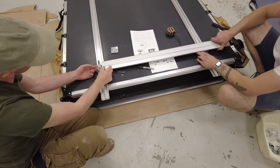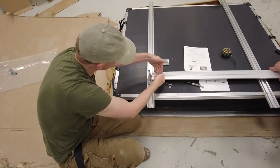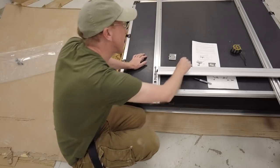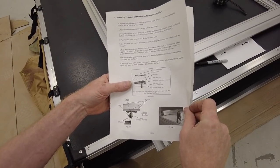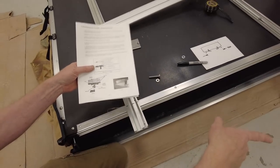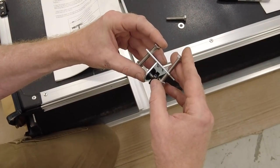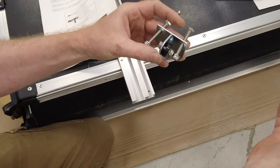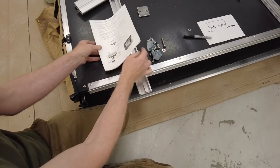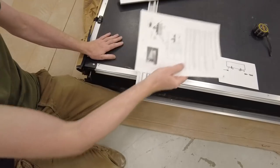This is a genuine problem with the fit. We might also 3D print a plastic spacer that follows the bar's profile to spread the load — otherwise the strap's going to start bending. On figure one, the ladder bracket bolts should have washers on both sides, but they've only supplied one washer per bracket instead of two. One bracket came with none at all. ARB, you need to supply the washers — you need ten small washers in total.